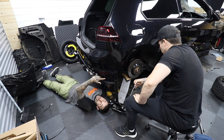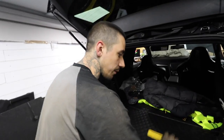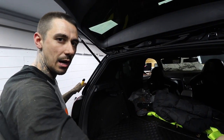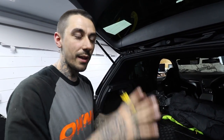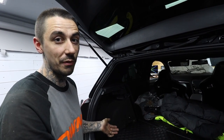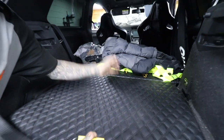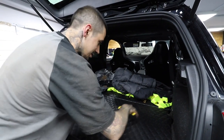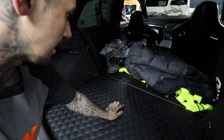We're slicing into this because we're going to do everything mounted on the surface of this for my very first non-pretty boot build. What I want to do is get the whole air ride running - I'm focusing on the external of the car to get it slammed on air, looking sick and working. Then when I've achieved that, for some future episodes I'm either going to go up to Offset and get a savage boot build done, or try and do one myself. Right now we're going to mount the four airlines and run the tank, manifold, and compressor through the false floor.